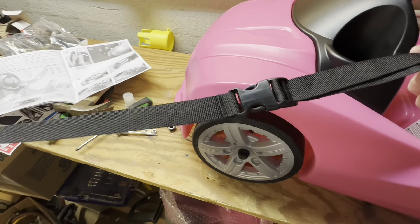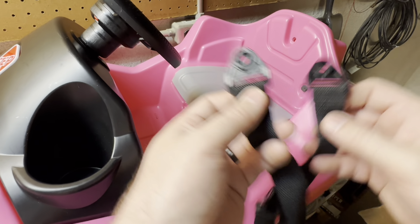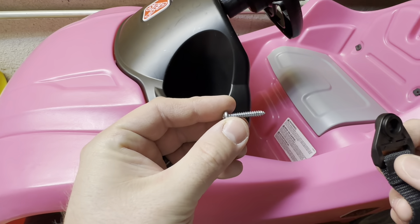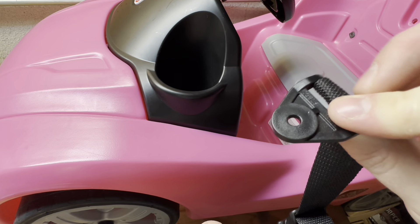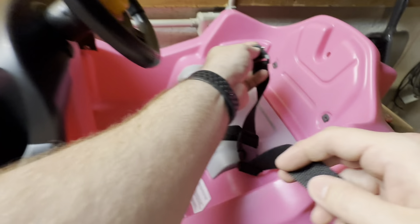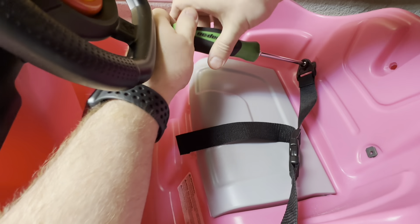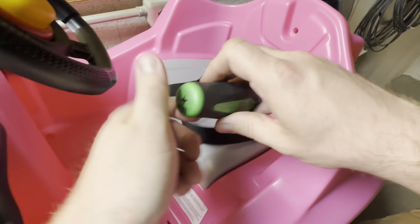Steps 13, 14, and 15: installing the seat belt. These two tabs will feed in with screws into those two mounting spots. I'm doing mine this way because being right-handed, when you buckle up you want to grab the strap to tighten it. We're going to use the two longer screws - looks like an inch long. There are recessed areas on these tabs and we want the recessed side so the screws fit right inside. I'll go ahead and start one on the right side, then start the other side before tightening all the way down.